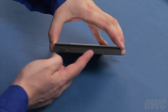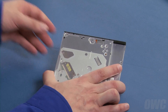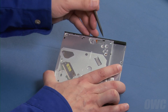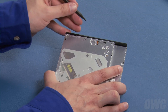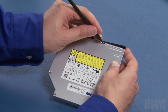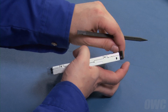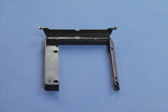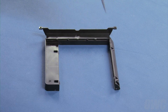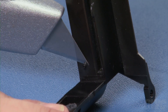If your new optical drive came with a front bezel installed, you'll need to remove it before installing it in your Mac. Use a screwdriver or nylon tool to disengage the two clips on the bottom, then flip the drive over and do the same on the top. There is one last clip to disengage on the side, but often loosening the previous clips will allow this one to come free on its own. Once all the clips are free, you can remove the bezel from the front of the drive. The optical drive carrier has two small pins that need to be removed in order to fit a non-Apple drive — carefully remove them with a sharp utility knife. Once these pins have been removed, you'll be able to install any compatible drive in the carrier.